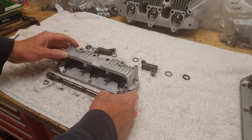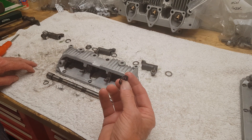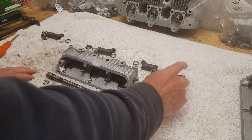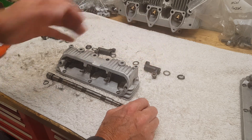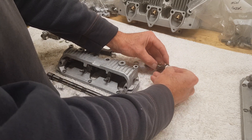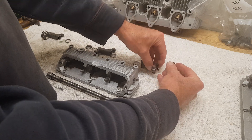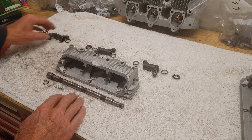You've got a mixture of Thackeray washers - these spring washers, a Thackeray washer like a little spiral washer - and plain washers. The way I fit them together is I always try to have a plain washer next to the rocker and then the Thackeray washers against the casing. That means the rocker has two plain washers to rotate against. If I had the Thackeray washer on the inside it would probably just rotate with the rocker, so it's much better the other way.